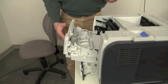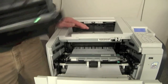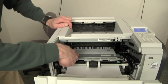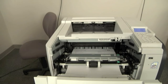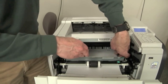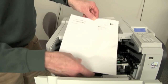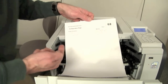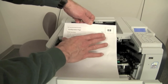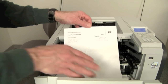Now I can take a look inside the printer. Pulling out the toner cartridge, I can see the image on the paper. Do you see the print in there? If I look inside and see my image defect, that tells me I caught it. If I don't see it clearly, I can lift this little green tab, move the paper forward, and pull it back out. I can now take a look at what the image looks like pulled out. Notice I only caught the top quarter of the page — I could run it further through if I wanted. This may take more than one try to get the image defect to show up.